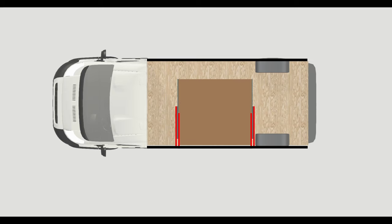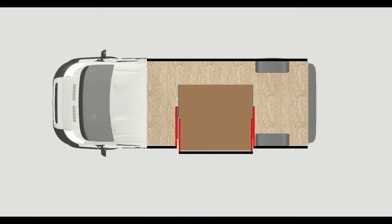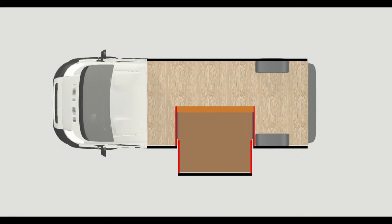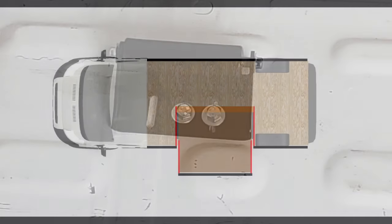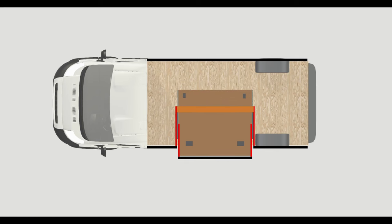The platform will have two walls attached to it that will be exterior walls when the slide is slid out. The platform and walls will be attached to the exterior wall of the van. The next step will be to cut out the exterior wall of the van so that it is only attached to the platform and the platform wall. Once the exterior wall is cut out, the platform will be free to slide in and out. Note that the drawer slides are extended when the platform is in and fully retracted when the platform is slid out. An overhead U-beam is added to help support the roof, attached to the two fixed partition walls. Two slide-out rollers are fixed to the floor of the van to support the weight of the platform and walls near the edge of the van. Two additional casters are fixed to the bottom of the platform to help support the platform above the finished floor of the van.